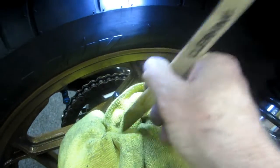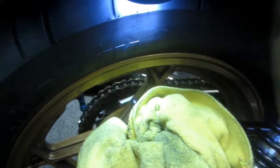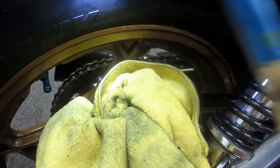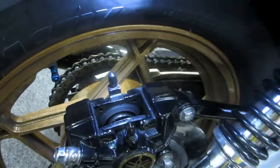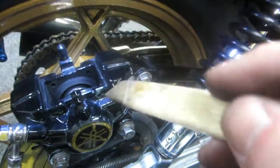Here's the reason I don't like to use brake parts cleaner on anything around the bike. Number one, it damages the paint - you get any on the wheels, and we spend a lot of time on these wheels, it can ruin paint. Number two, M600 is real good if you have it. Simple Green is even okay. To clean as much of the dust and grit out, when I'm all done I'll wipe the rotors with brake parts cleaner on a clean rag.